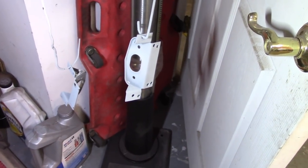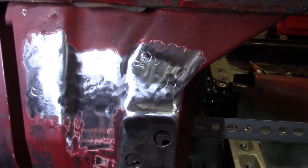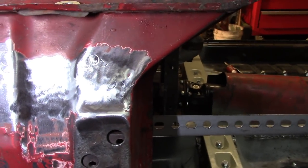I got the brackets cleaned up and primed on the inside — they're drying there, stuff dries pretty fast. I'll show you the spots I've prepped on the body. There's the driver's side — you can see those swirls where the spot welds got drilled out, shiniest piece of metal on the car right now. And the other side is obviously going to be the same, but there's one little hole there above one of the drilled-out spots.